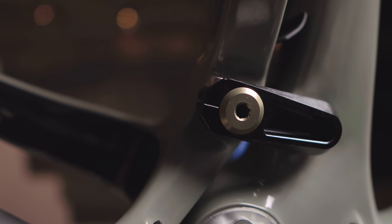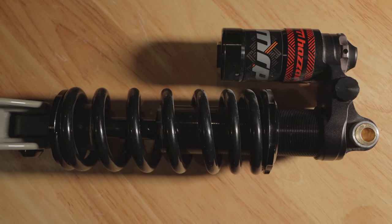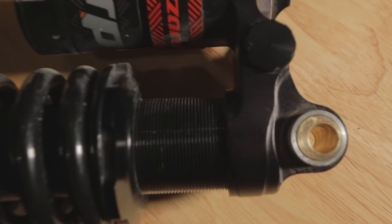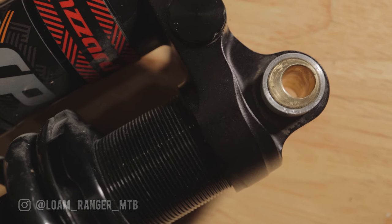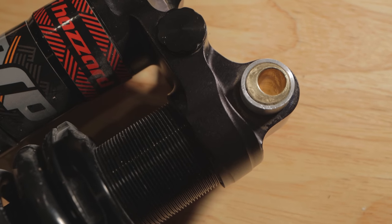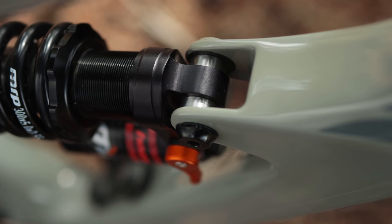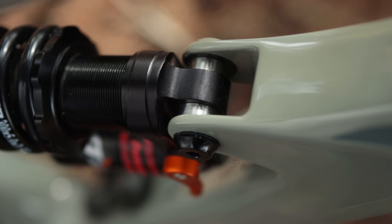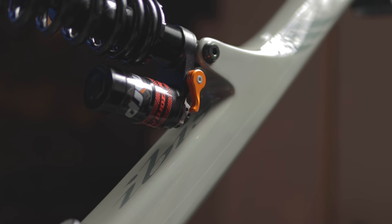Now it's time to ruffle some feathers with one of the most important changes we're going to make to this bike. We're installing a single offset bushing in the front shock mount in the reversed position. This isn't recommended by, well, anyone, including the bushing manufacturer. But installing this 1mm offset bushing should help raise the bottom bracket height close to where it would be in stock form, without causing much of an issue with how the suspension linkage operates. It essentially makes the shock's total length slightly longer, which pushes the entire rear triangle back and down. The question is, will the bushing spin itself around under hard riding? We'll have to see.